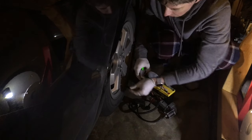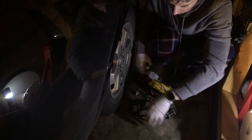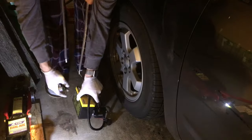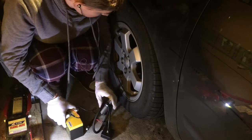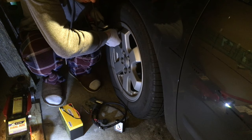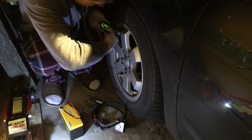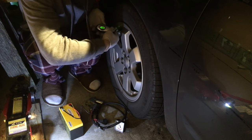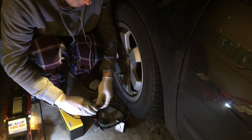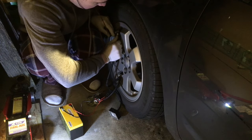Make sure you do this in the morning. I did this early this morning after the vehicle had been parked all night. You don't want to do it after you've driven — you want to let the tires cool off all the way. That's called cold tire pressure, and it's important to make sure you're getting the actual correct pressure. When you drive, the tires heat up and that causes the air inside to expand, which increases the tire pressure. So a hot tire pressure measurement is inaccurate — you always want to fill and measure tires when they're cold.